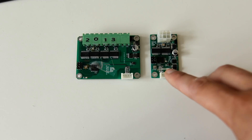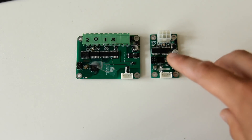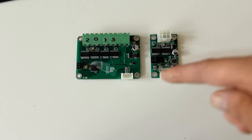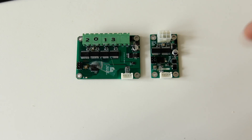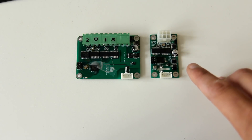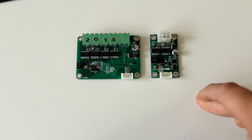That is exactly what I'm doing here: I'm taking the messages from the main high voltage battery in the car, as well as the messages that this PCB is going to send from the extender, adding up the capacities, and then sending that to the main computer of the car. The main computer then computes that it can go many more kilometers than it thought, which means on the dashboard I now have the correct amount of kilometers of range left, instead of something much lower.